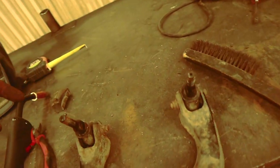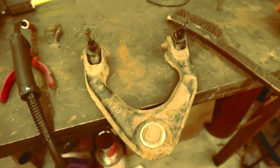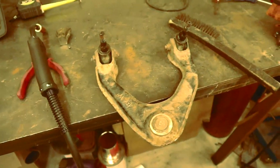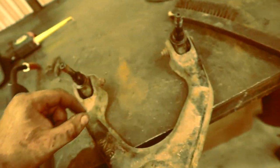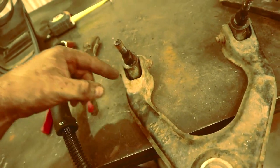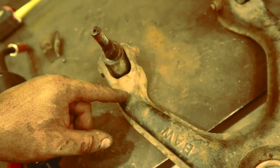The tire is just straight touching right now. Getting to the point where I'm about to start calling this urban hot rodding. Now I'm going to mod the upper control arm, because they don't sell adjustable upper control arms for the Prelude. The best spot to cut would be right here, so I'm just going to chop an inch off each side — actually, I'm going to cut one and slide it underneath.